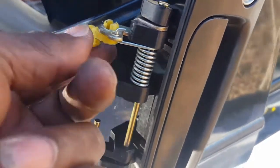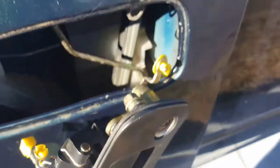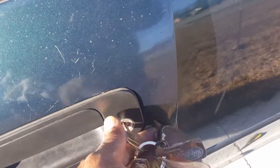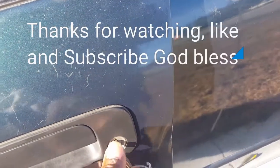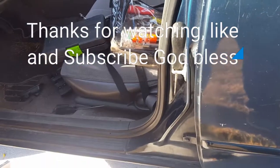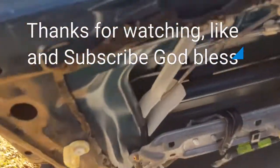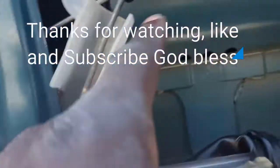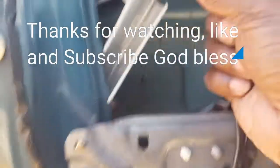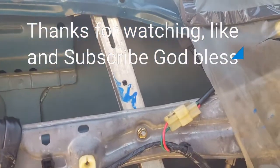That's the door lock clip — pushed through and then the prong pushed onto the cable. We do the same on the inside latch. This operates the door lock. While putting the tang on the key switch, I found it easy to work the lock while turning the key to get it in position. Then bolt the handle back on, and those clips just fold over and clip onto the metal prong to stay in place. Now just put the door panel back on and hook everything up — we're done with this door.